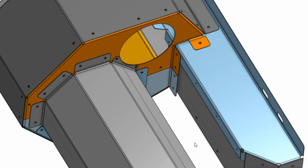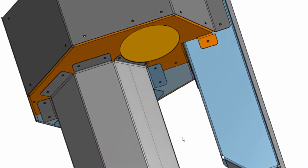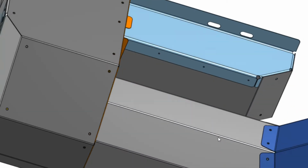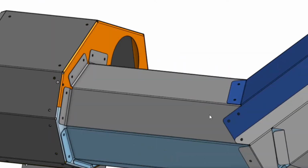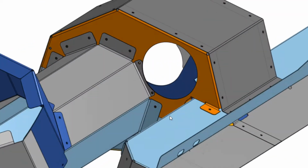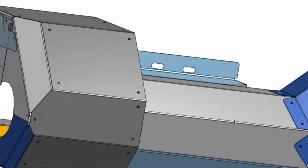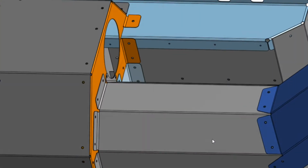Otherwise, you could also slit the galvanized fitting a little ways back and force it over the top of the aluminum tube and then screw it on and then tape over that connection with some of that galvanized tape. But that may require a little bit of creativity on your part because we're doing this patch in a hurry on these. Okay, that's the tin set for the early model 8010 when they still used a wastegate actuator on the turbocharger.